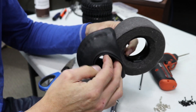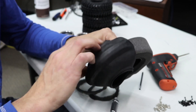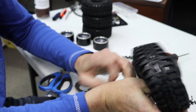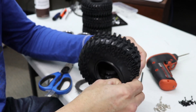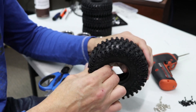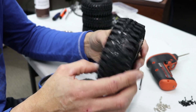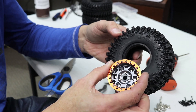Fit the tire over one side and then pinch it with your hand from the back — pinch the beadlock ring and the tire together from the inside — then roll the tire right over the top of the rest of the wheel. Just unfold it right side in over the top of the foam. Done! No stuffing, no weird stuff going on. You can go around the tire and make sure it's sitting square. Super fast, super easy, and with the beadlock ring in the tire there's a very low chance you'll tear the foam.